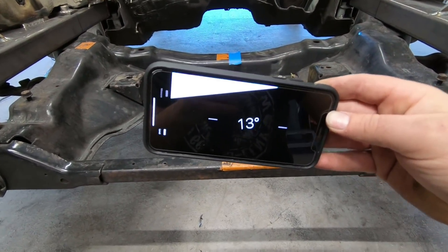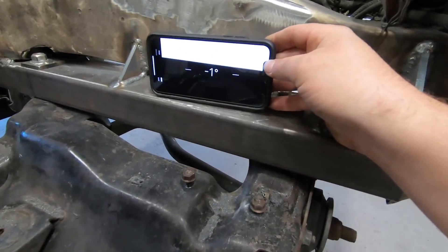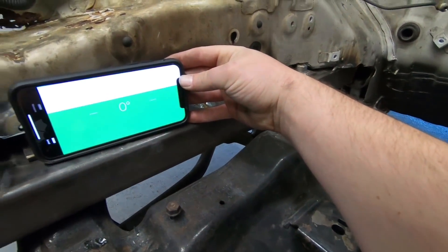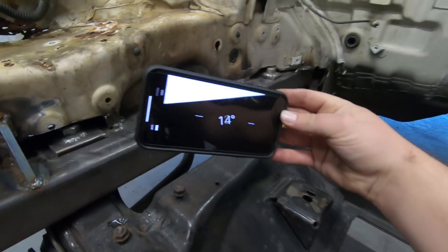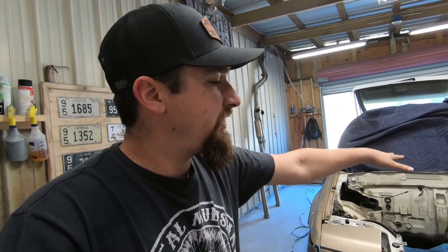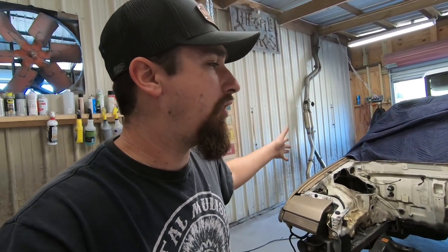This level is pretty accurate for an iPhone — I've got an analog one but I actually like this better. The frame rail right here is zeroed out, and also right there zeroed out as well. Since I don't have a full frame table or any professional setup, my goal was to get it within one or two degrees. You guys know how I think: good enough is not good enough. And we're zeroed out everywhere, so I'm happy with that. Now we've got to move forward and build everything out to bring the structure back — it is strong right now, but not strong enough.